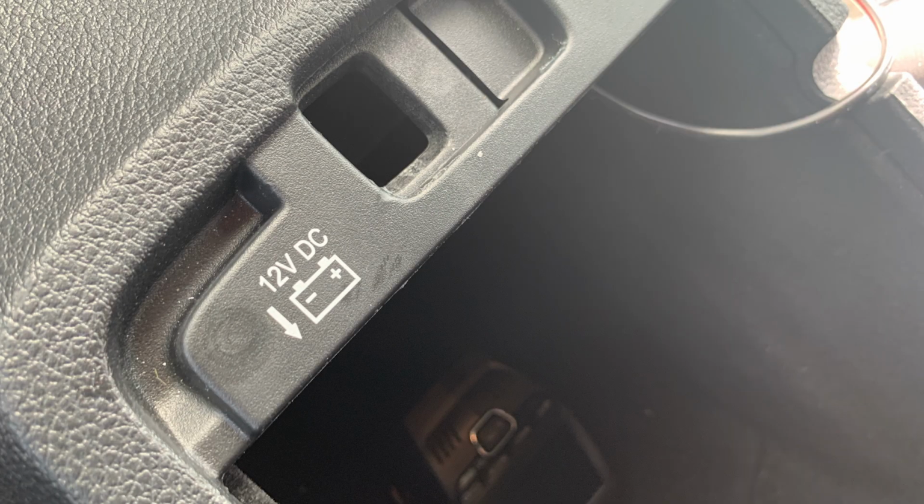In my last video about installing a dash cam in the Jeep Grand Cherokee, one of the subscribers mentioned that it looked like I had hooked up the camera to a terminal which has direct access to the battery. And sure enough, that's exactly what I did. This particular accessory adapter, indicated by a battery on the logo, is a constant feed directly to a battery source. That's not what I wanted for my dash cam.